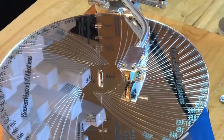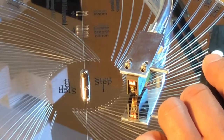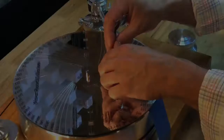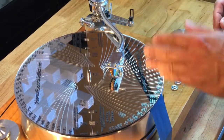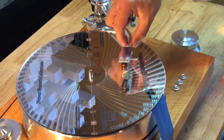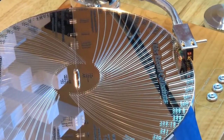I'm hoping that now I've got it in the groove at point one. I am extraordinarily close — really, really close. I could stop here and accept good enough, or I could make it perfect. I'm going to make it perfect, because I want to optimize my vinyl playback. I have almost imperceptibly pushed the cartridge a little bit further towards the pivot point. Now I bring it back to point zero, drop it down, and see how much I have to spin the Wally tractor — barely anything at all, but I'm going to do it.